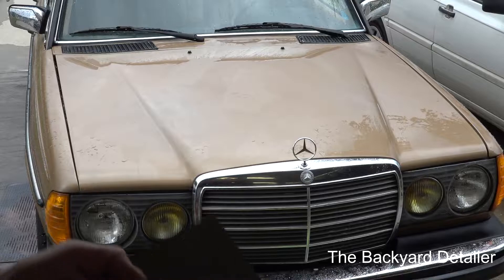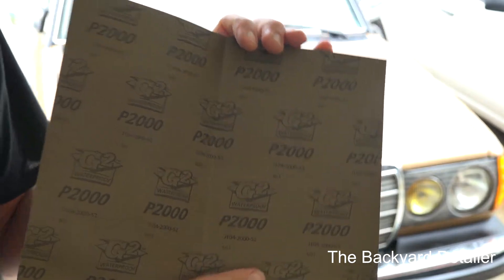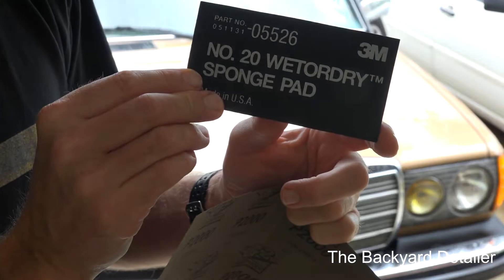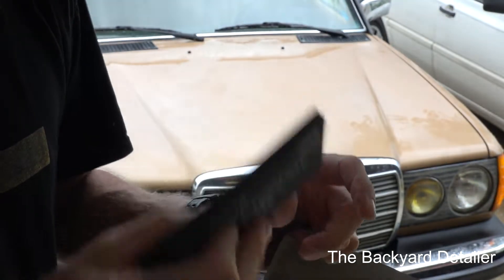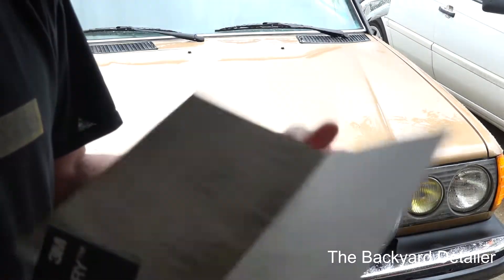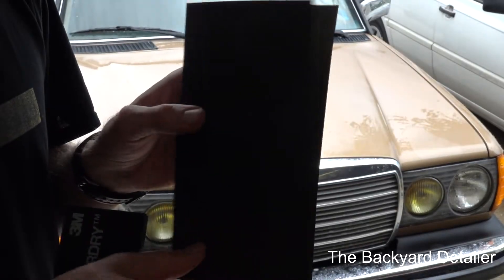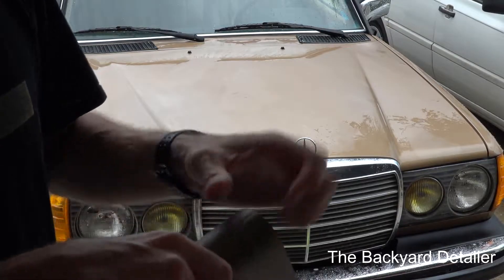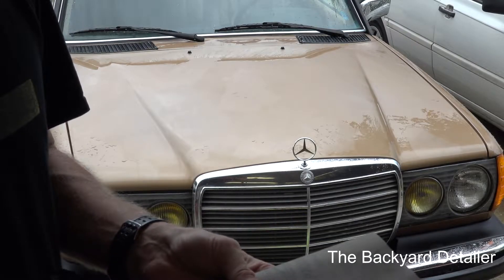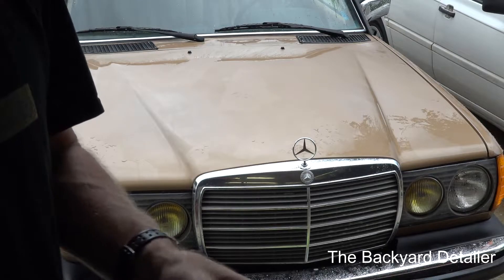All right, so this is, as I said before - while the light's not cooperating - 2000 grit wet-dry sandpaper. This is a 3M number 20 wet-dry sponge pad, and this is what we're going to be using as our sanding block. I'm going to fold this 8.5 by 11 sheet of paper in half, and fold it in half again, and then rip it - one piece will be more than plenty.